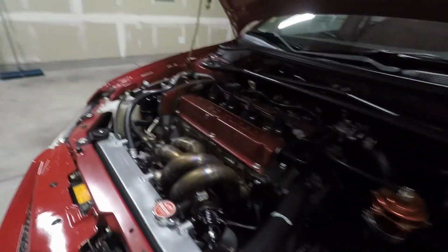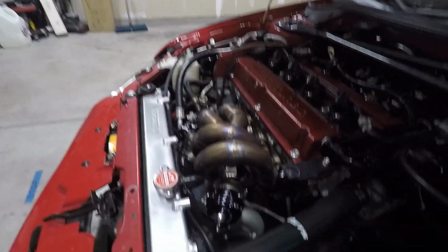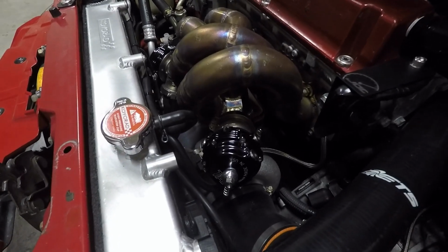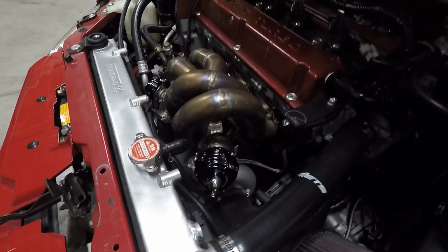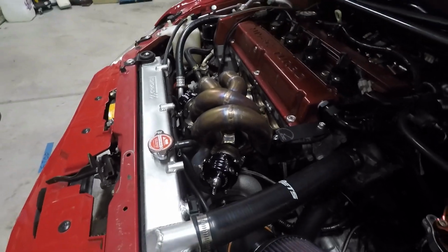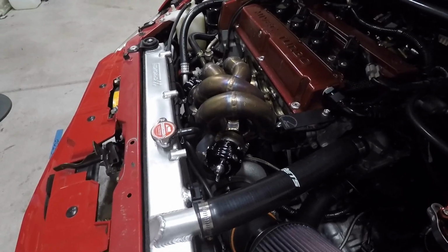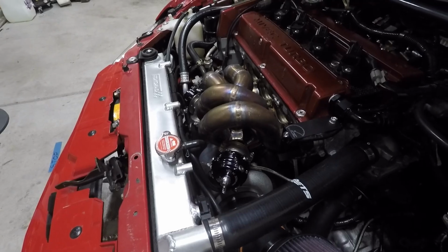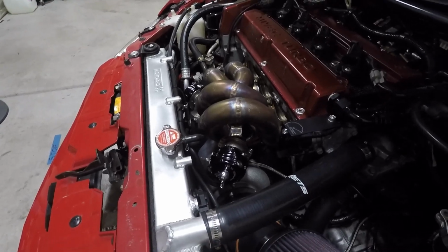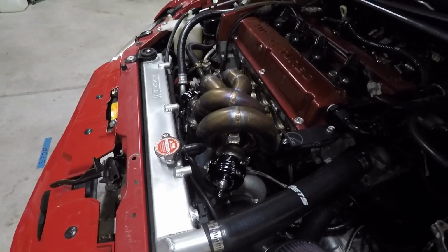With this kit it just looks like the venting may not be all that great for them. So they might actually blow over their actual PSI rating. I did call and talk to the manufacturer. They did say that it is not uncommon. They do see this. They did recommend that I go down to 0.9 bar springs, which I believe is 13 PSI. So I do have that spring combination here in hand, so that's probably what I'm going to do.